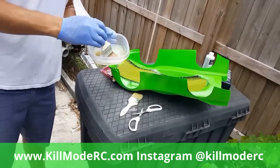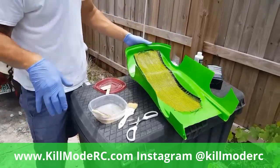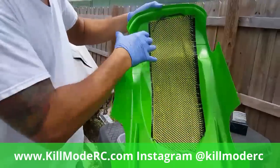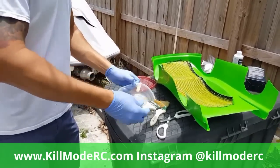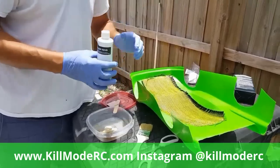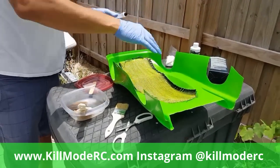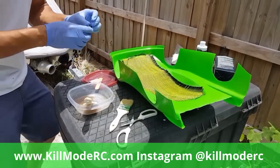I mixed up my resin and it's starting to dry already because I waited to do this video, so I'm going to add a little more. I cleaned the body, painted it up, mixed up my resin - I apologize because I started without making a video. I cut a sheet and I'm going to reinforce it in pieces rather than try to do a whole sheet, because it's difficult. I'm just using regular fiberglass resin with this - it's not carbon fiber specific resin. I cut the sheets out, shaped them a little bit, and added my hardener - probably a little too much hardener though.